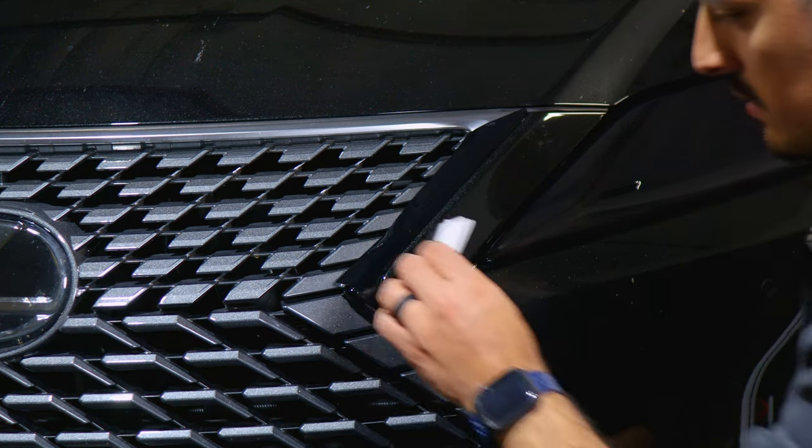The last thing to do once you finish installing the whole front grille piece is pulse heating all around. That way the adhesive on the film activates and it sticks better to the panel. Grab your heat gun — if you have a heat-resistant glove to help you wrap around edges, you can use one; if not, you can use your squeegee as well. That concludes the installation video for the chrome delete for the front grille of the Lexus RX 350. We hope this video helped you with the installation. If it did, drop a like, make sure you're subscribed and turn on the notification bell so you don't miss any upcoming installation videos. Thank you so much for watching and we'll see you on the next one.